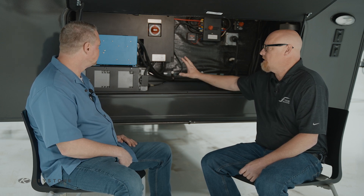Should you watch the app while using this system or just periodically check in? Everything in the coach requires power — even running one little LED light is still consuming energy out of that battery. If you're out in the sun putting in five to six hundred watts you're putting in more than you're taking out. But if the sun goes away and you're running an air conditioner with five hundred to a thousand watts coming out but only a few hundred watts going in, you're going to have to watch your time remaining, because you can run your way into a dead battery situation and that's not something you want to do.